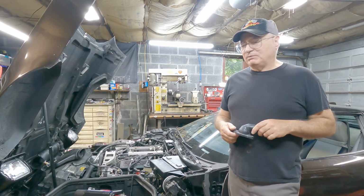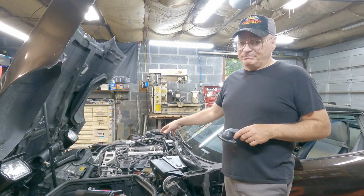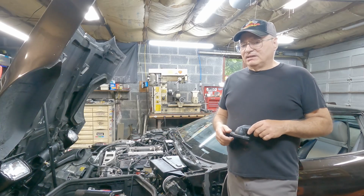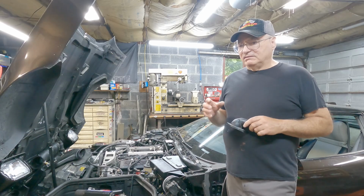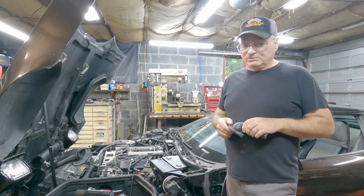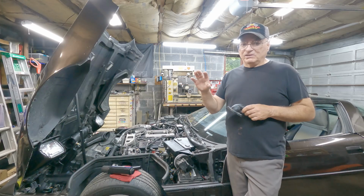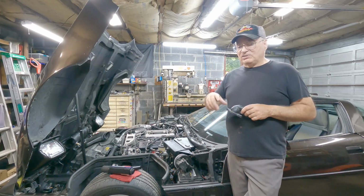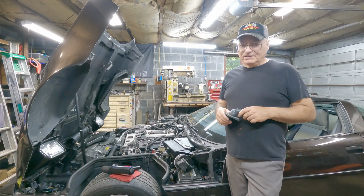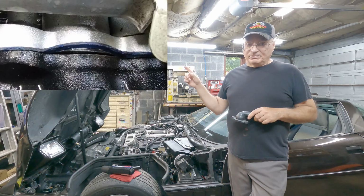I wish I used them on the base too, but right now, as far as I can tell, I don't have a leak on the base, and everything's sealing up really good, so they're going to stay there. The upper gaskets, the ones for the runners on a Tune Port, the factory original style that you can get from Fel-Pro, are made out of metal coated with a paper too. Those don't twist or blow out or distort unless you do something really serious to them, like that one did in this picture.